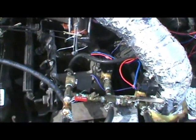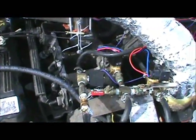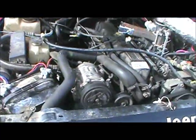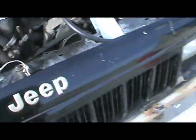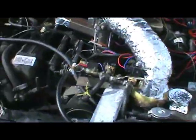So I had to connect up these solenoid valves right there. Those are so I can control the fuel from inside of my car. I have the electronic solenoid valves, and then I also have a manual valve to shut it off manually when I'm out here doing testing. So that's a nice option to have. What I have here is a valve that goes over here to this reservoir test tank. Right now, it doesn't really matter, but I've got about 2 cups of gas in there.